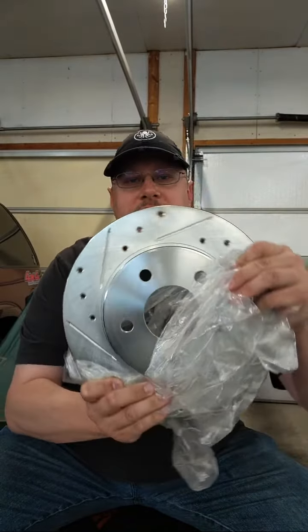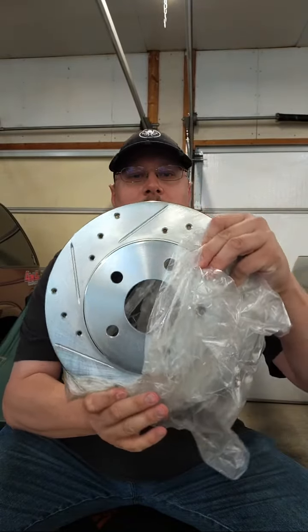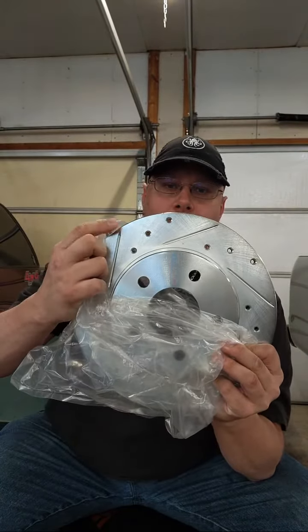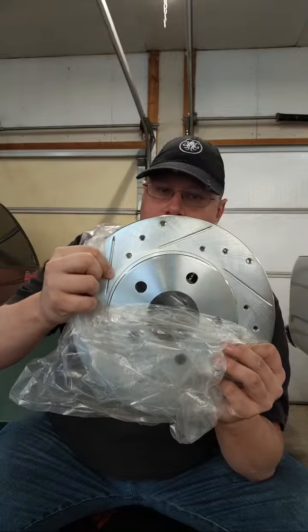It's better to see the heat spin off the rotor than to see it being pushed in. You don't ever want it cutting in — you want it to sling out. This is the most important part of a brake upgrade like this. If you put these rotors on and install them in the wrong direction, they're actually worse than the stock brakes. And it's a mistake that is often made.